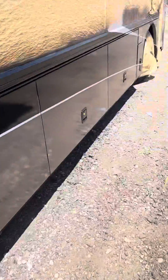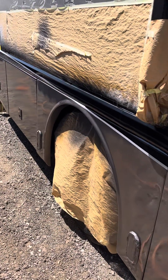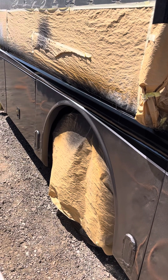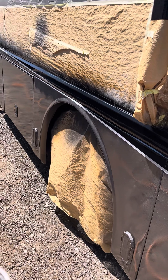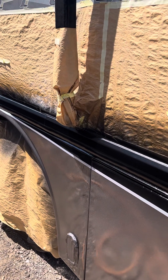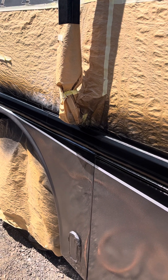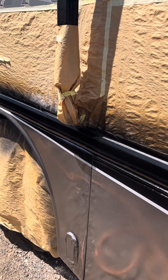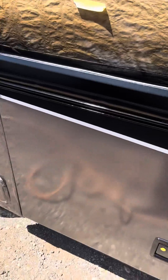So I come over with my high solid. This has been done with the 50% mix, and now I'm applying the super high gloss. I mix it clear — about 70 to 80% clear, 10% reducer, but it depends. You've got to check your viscosity. I stick my stick inside the cup when I mix it, pull it out, and count one, two, three, four, five. When all the clear runs off the stick at five seconds, I know I've got the right texture to shoot the glamour coat — the top coat, the very last coat.